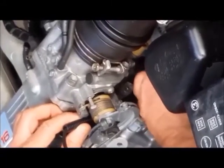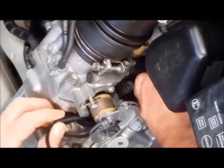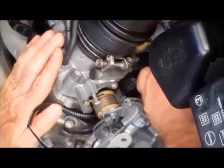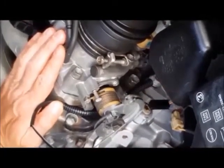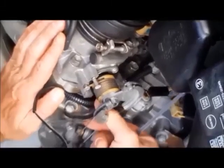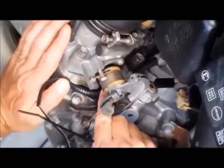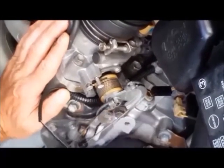It's really important that for longevity of the sensor, you've got to make sure that you secure the sensor cable using corrugated tube here to the cylinder head. That means there's going to be no twisting or vibration — it'll vibrate at the same rate as the cylinder head and your engine. That'll mean that your temperature sensor will last the longest possible time.